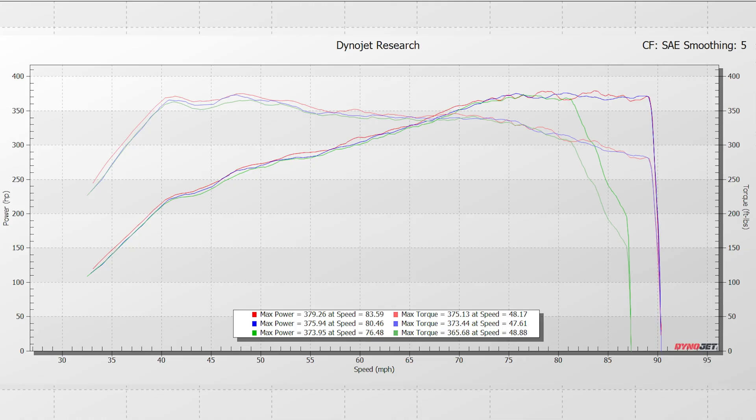We're done testing the ETS top mount intercooler, and the car did make some pretty good power on the first couple of pulls. But on the third pull, it got unhappy, so we had to get out of it a little bit early. Even a really good quality intercooler like the ETS one is going to have its limitations when you're around that 380 to 400 wheel horsepower range. We are realistically at the point with this car and the mods we've done where we're ready for a front mount intercooler. Even a high quality intercooler like the ETS one is still going to suffer from hot charge temps just due to the fact that it's located in the engine bay.